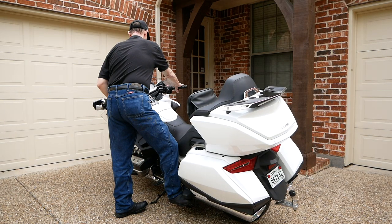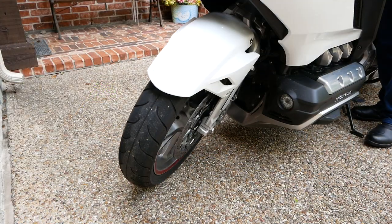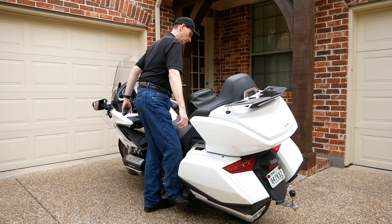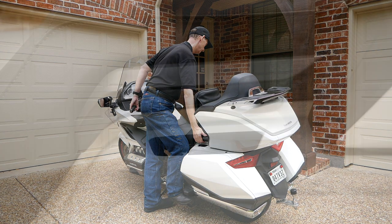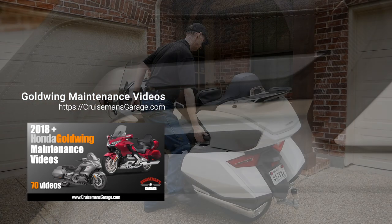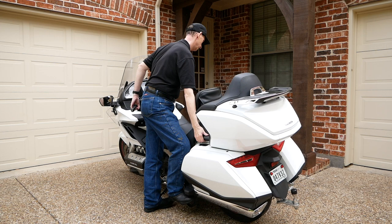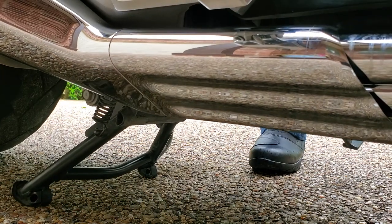Let's stop it and take a look. My right foot is on the center stand pad and the left center stand footing is on the ground. Now I want to turn the front wheel completely straight — it should be pointed straight ahead. Once the front wheel is straight, I step as close as I can to the bike and grab the passenger grab rail as firmly as possible, with my left hand on the left handlebar grip. Then applying pressure with my right foot, I lift the motorcycle up and over so that both pads of the center stand are resting on the ground. Once it's in this position it isn't going anywhere.